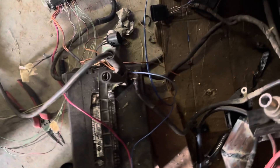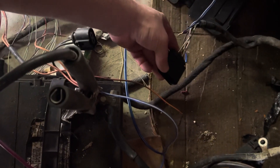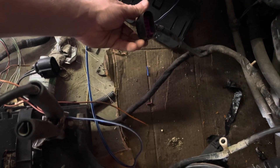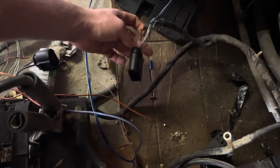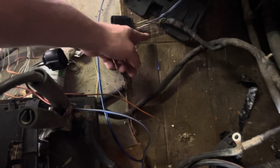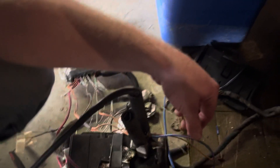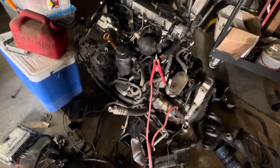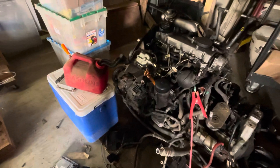Now we're in the basement. I've got this ECU - it is programmed. The brown wires are going to negative. This is the T14a plug I was talking about. You need to wire that harness so the two wires go to positive and the one wire goes to negative - ground. I ran it through some old speaker wire, which is enough to hold it. I do have a wire for the glow plugs but it's not needed - it starts up no problem. It's running into a gas can with diesel fuel.